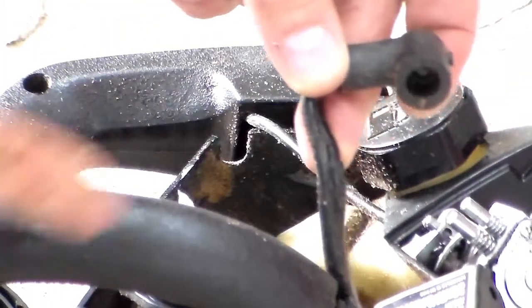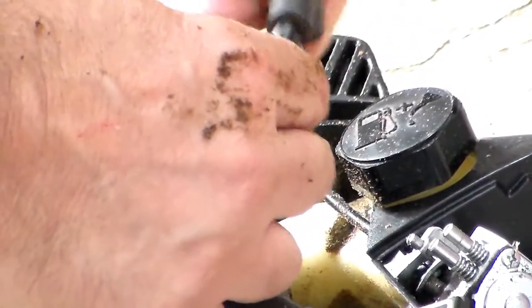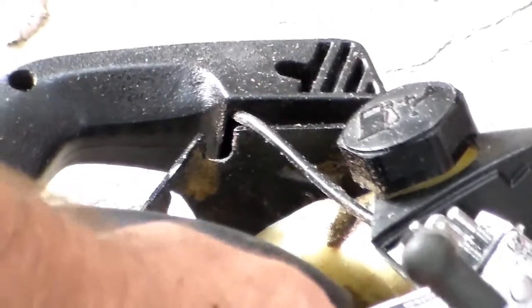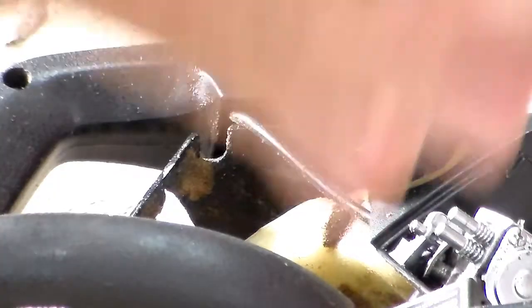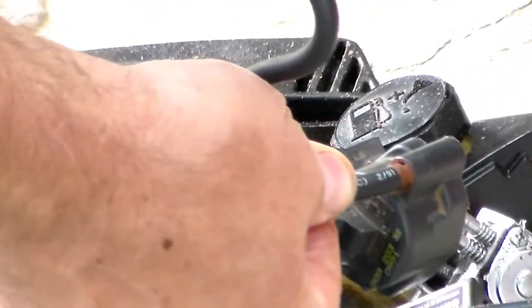You can see what I'm seeing right here — the wire is all smashed in and it doesn't feel solid anymore, it feels kind of gummy. I'm definitely going to replace that. The chainsaw was harder and harder to start, especially once it would get hot, and if you'd move around the plug wire it would start up. As I can see, that's all ripped up, and that plug wire is actually an integral part of the coil.